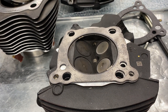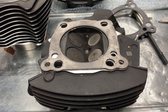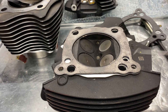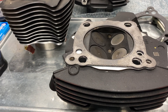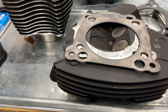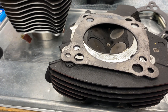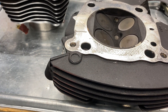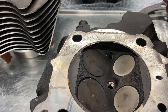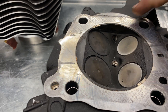Unfortunately, I've had a bike leave here that was cammed and had a dyno tune. It's probably done about 600km and there was a head gasket failure. The thing is, if it were due to excessive heat — which unfortunately the customer was told by someone else — when we take these gaskets off, the actual bonding on the gasket surface that mates to the head and the cylinder gets really hard to pull off when there's been a lot of heat in them. On this one we've got some marginal debris, the sticky stuff left behind — we've marginally got some of that because there is heat here.